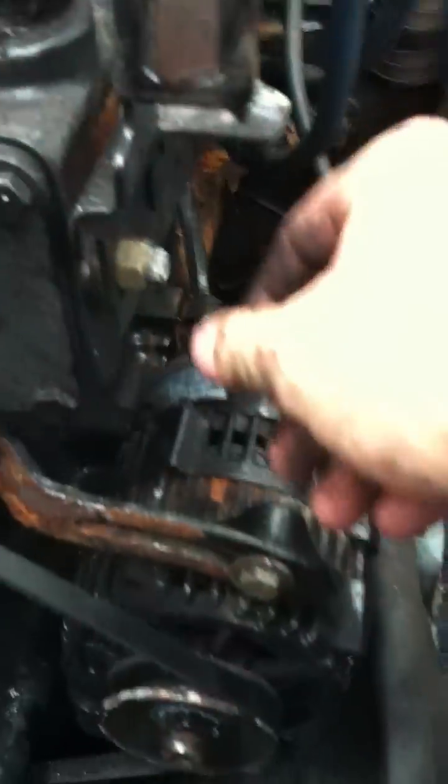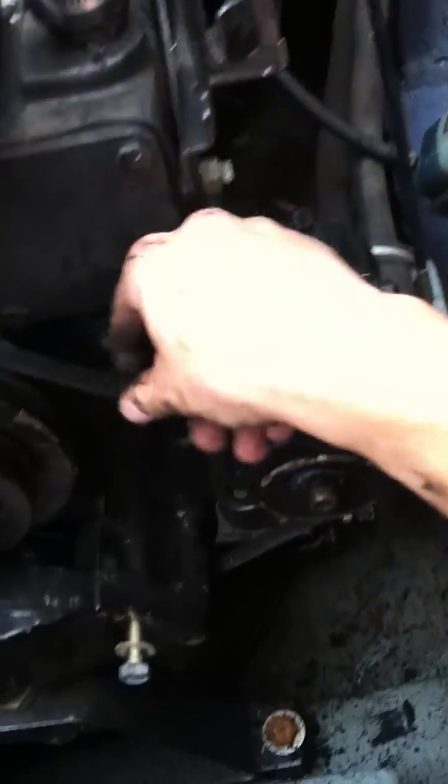Just to give one little more update on what I did: I took my breaker bar, stuck it in between the alternator and the engine mount, and just pulled in there and it straightened out the belt real nice. That's all you need to do — throw it all back together and start it up. If I have any issues, I won't upload this video.